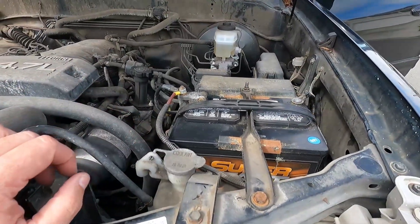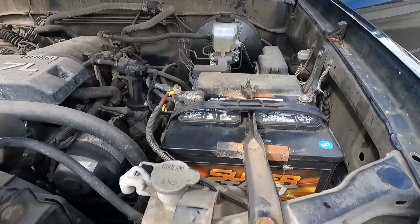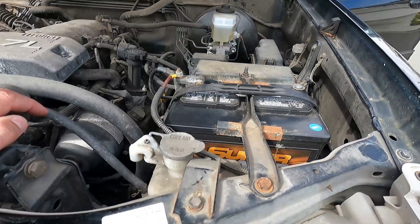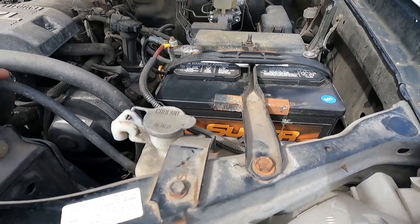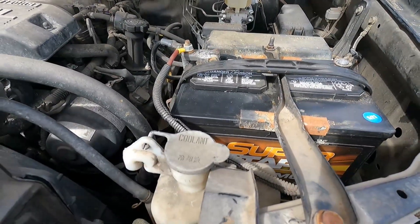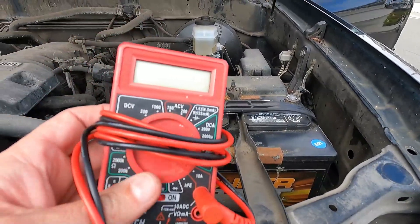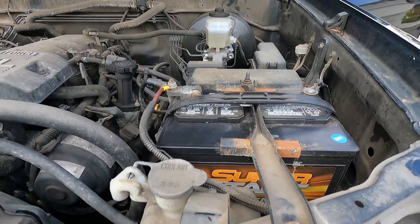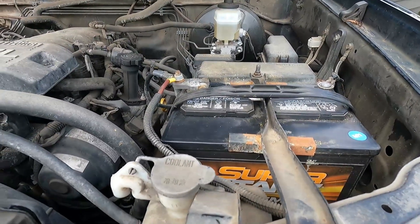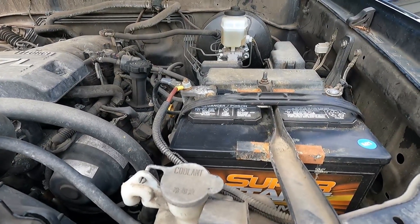So really just a dead battery from sitting — that's all we had to deal with on this one. If you plan on parking the vehicle for a long period of time, you can get a battery maintainer or battery tender to keep the battery from going bad. In this case, the NOCO Genius5 smart charger didn't show any errors — we let it do its thing and it starts the vehicle no problem. Now you know a simple way to test for a parasitic draw with a multimeter. Please give it a thumbs up and subscribe — I'll get links to the parts and tools in the description. Thanks for watching and good luck!